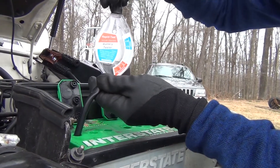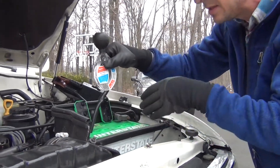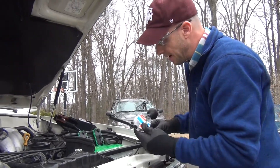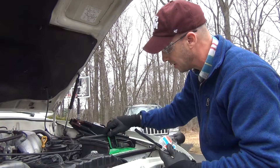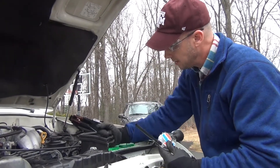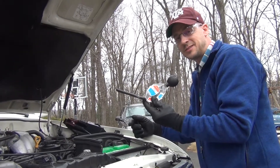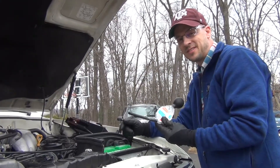So that's our problem — the battery has gone bad. What happens is the plates inside these cells will eventually get corrosion between them, and when they get corrosion they don't work as well — that's the end of the life of your battery. So again, be very careful with this stuff. Now I know I've got a bad battery. I've got time to get to my favorite Interstate battery sales place and get a new battery. That hydrometer costs $4.95, so anybody can check their battery. Alright, until next time, this is Clay in Texas — we'll see you next time.